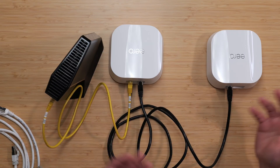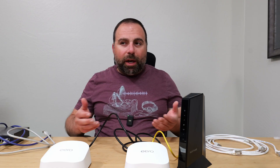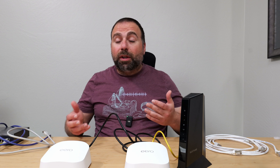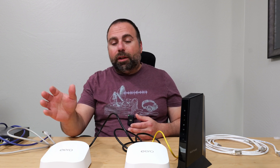Keep in mind that if you want wireless backhaul with better performance, you could get better mesh systems that provide better speeds on the secondary. The Eero 7 is not the best for wireless backhaul due to being dual-band.